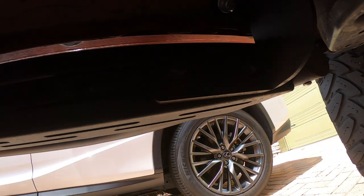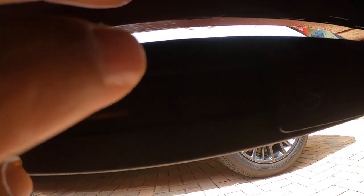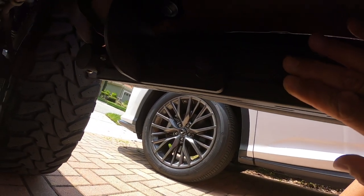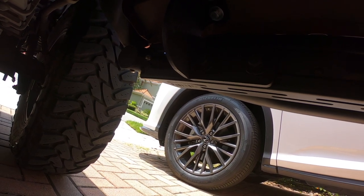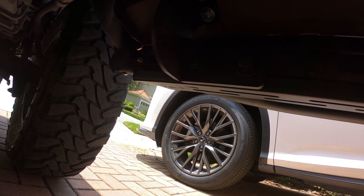The front piece is different. You'll see that the sliding piece has the two black bolts bolted onto the rear, and there's one empty one in the front. Make sure you set it up that way for the front — this is right by the driver's side pedals where your feet would go. On the rear of the driver's side, you're going to have an empty hole in the front, and the sliding bracket will have two black bolts in the back. The end of this running board where that rubber oval is lines up almost perfectly where the end of the actual truck frame is.